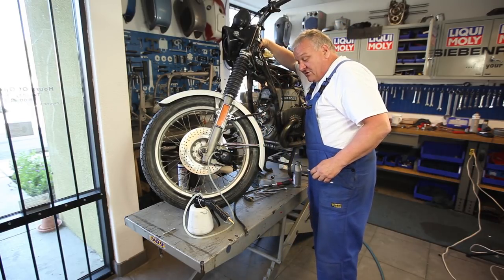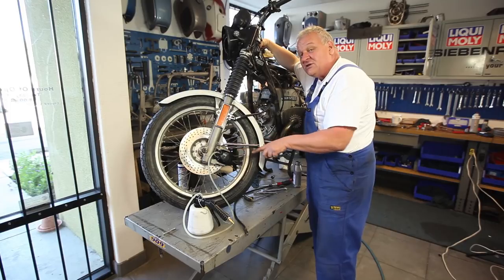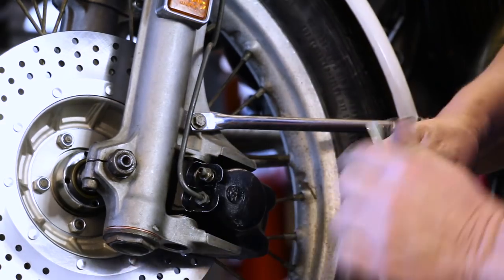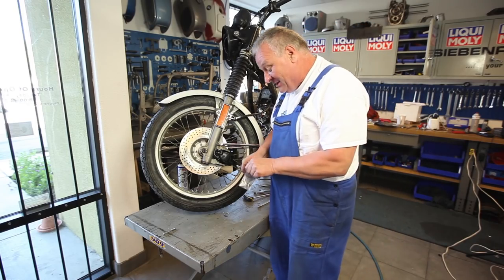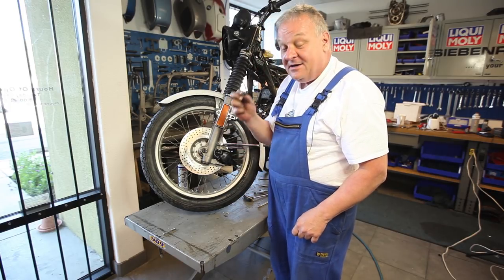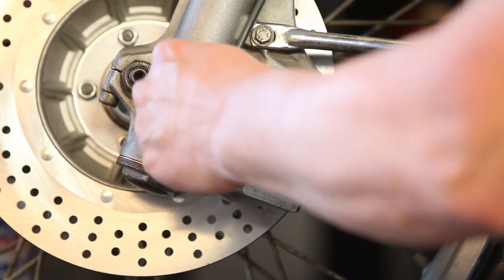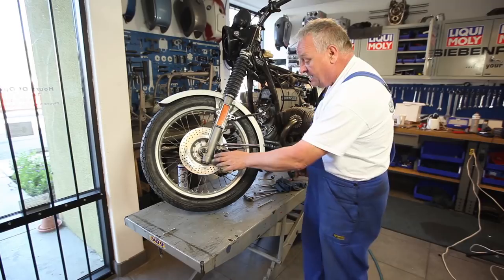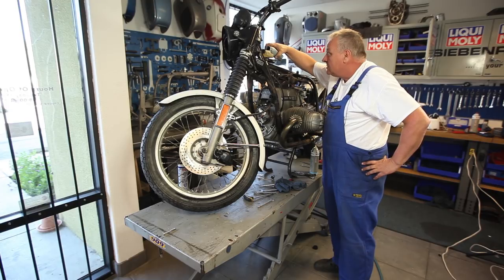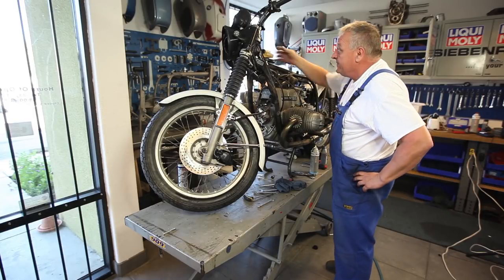As a final step, I like to manually bleed it at the end. Hold the wrench on there, grab and squeeze the brake, crack the nut, let some fluid flow through, close the valve, let go of the lever, pump it a couple of times — run through that a couple of times to make absolutely sure there's no air coming through. With the vacuum bleeder it all happens so fast you can't really see, but I'm seeing a real constant flow of brake fluid so it's pretty good. Top off the fluid level and put the cap back on the reservoir. We've also got these original ATE brake bleeder caps to put on.